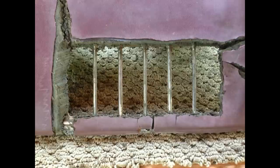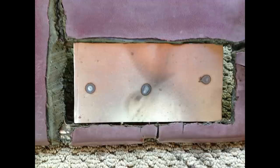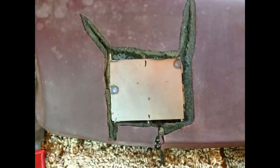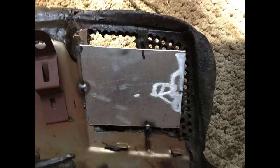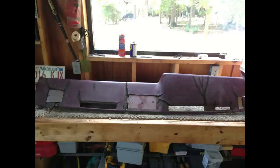The previous owner of my truck had already cut speaker holes in the lower doors, so I decided to use those locations instead of the dash speaker locations. I cut the foam grills out of the dash and scraped all the foam off, then I welded in plates so that when I spray the foam on there, the foam wouldn't just go straight through the dash. You could probably use wood or cardboard, but I was concerned about a fire starting under the dash — that's why I used the steel.